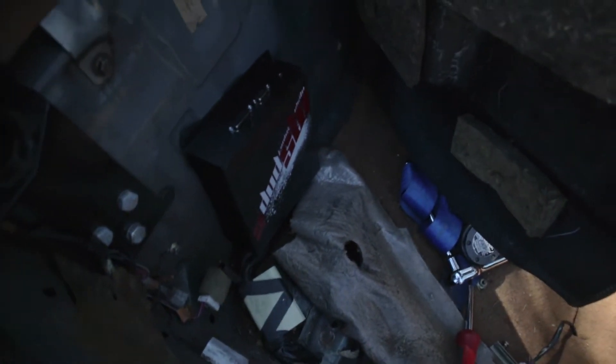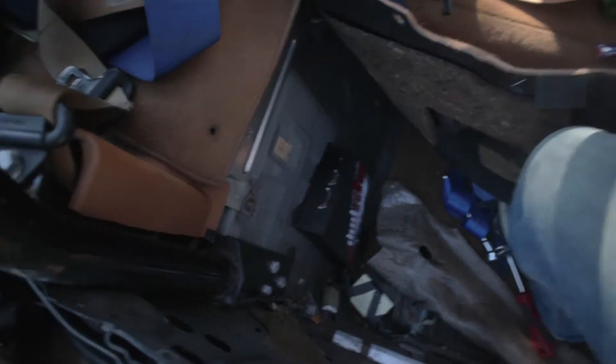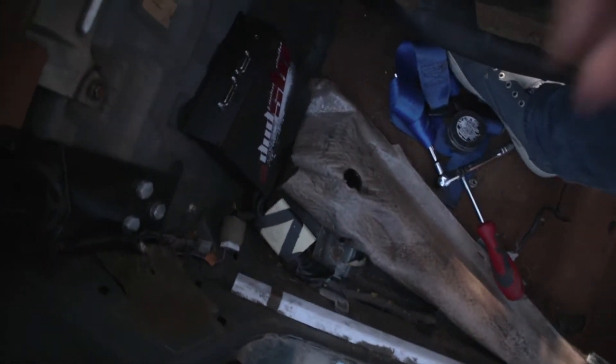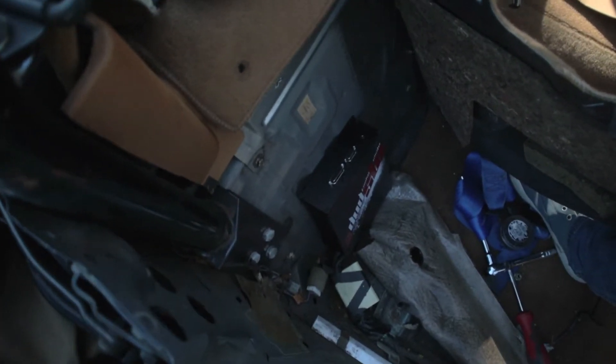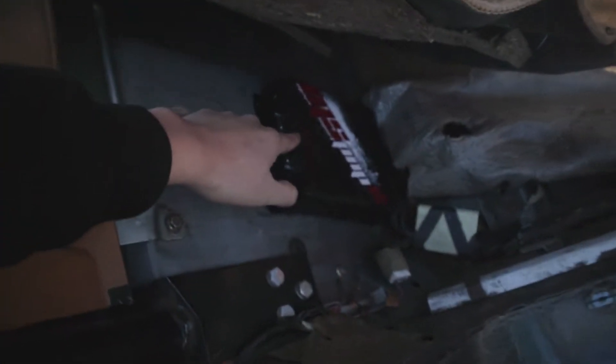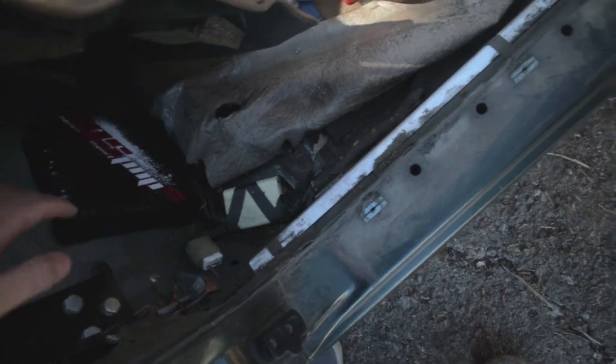I have the ECU in right here but it's not actually attached to anything — it's kind of just out here on its own. What was suggested was some ECU tape, which is like really sticky double-sided tape. I'll probably just tape it here; I don't want this to move and possibly mess up the map line. That's going to be run from here, looped down through here. I'm going to figure out how to get the map line ran through these tubes — I assume that's what these are for because they don't serve any other purpose.